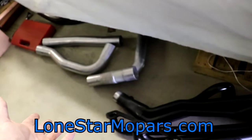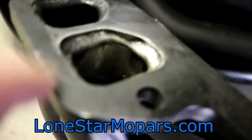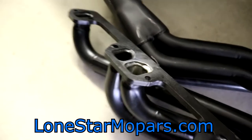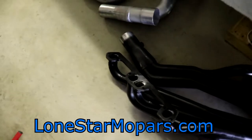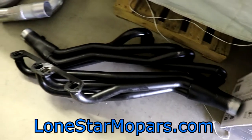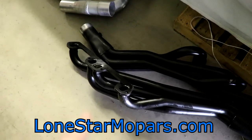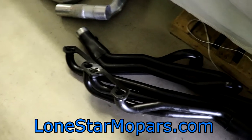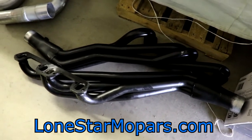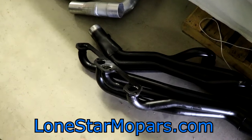The V-band will go over and love-tap into place, which is good enough for me. Got the collector on the driver's side here. The driver's side had that primary right here where a prime weld just sort of skipped over it — that's not good, that would be a terrible exhaust leak. I'd venture to guess the vast majority of people who got these shipped to them would have thrown this on the truck. I'm not bashing Pacesetter; I like that they're made in America and basically the only long tube header that exists for a 5.2/5.9 Magnum. It just really sucks that this has set me back a bunch of time.